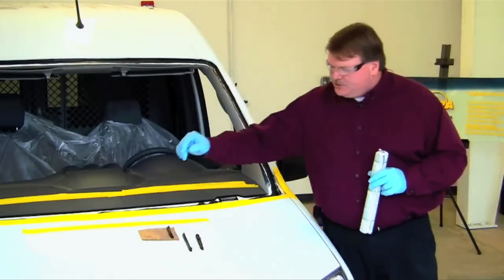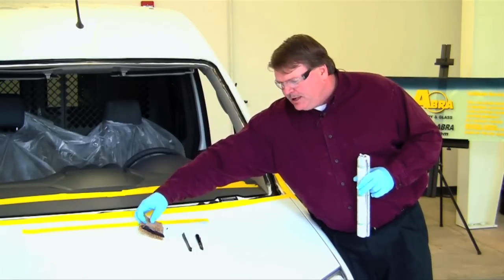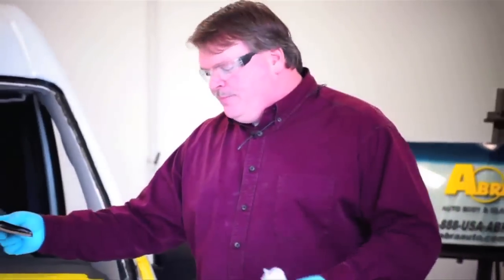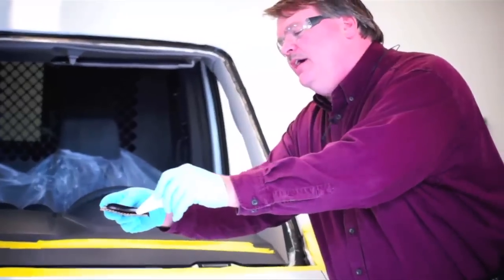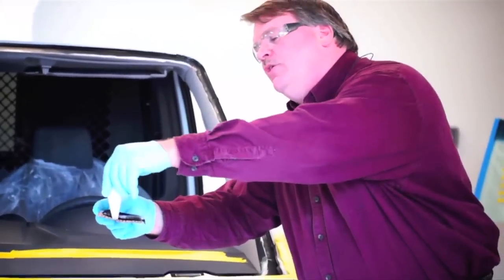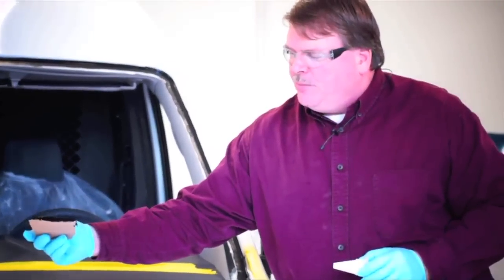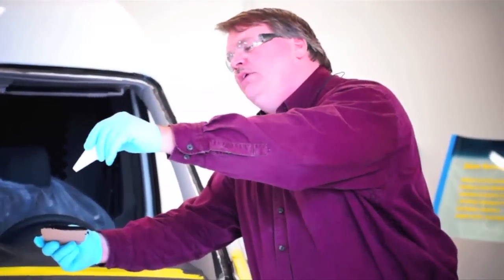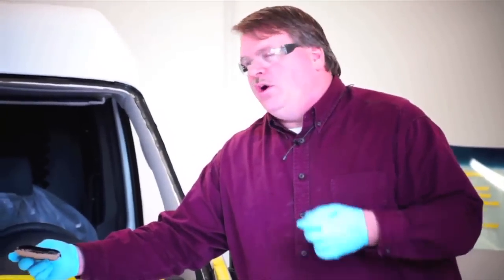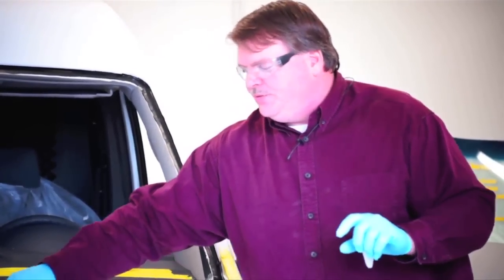Here we've applied a pyramid bead on a piece of cardboard using a 45-degree angle. If you look underneath, you can see air gaps all the way underneath there. When the gun is not placed at 90 degrees and tilts over, the adhesion level to the pinch weld is not what you want. This can cause leaks or upset the adhesion level, which is a major factor in a car crash. You want to make sure you're getting proper contact with the pinch weld and optimum contact to the primer on the glass using that pyramid shaped bead.